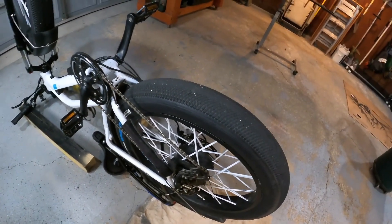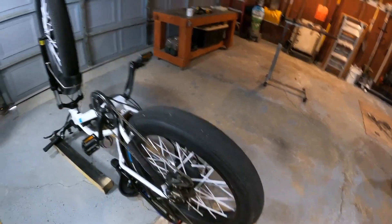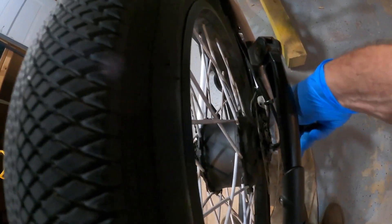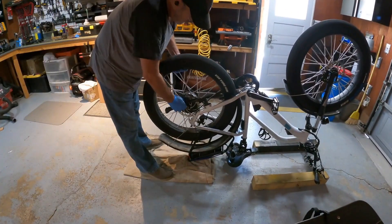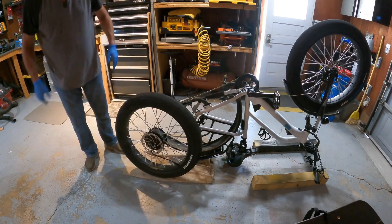Now the next step is actually removing the tire - and that's all there is to it. The pro tip here is the 10 millimeter wrench. Because your shaft is flat on two sides, the 10 millimeter wrench fits right over that and helps you shift the tire into place while removing it off the rim. Now we've got everything disconnected and our wheel should lift right out.